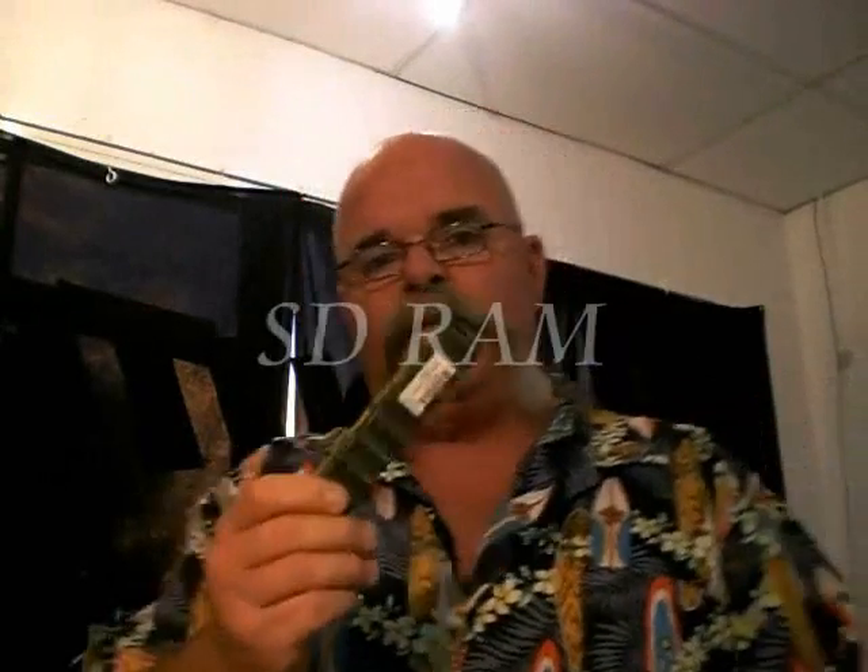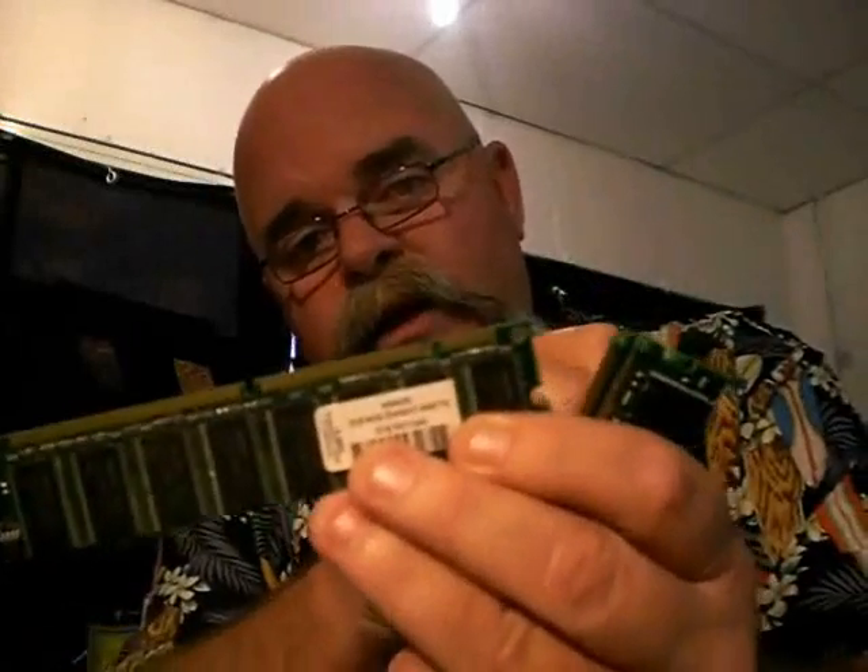Now this is a stick of RAM. This is called SD RAM — this is the very, very early RAM. If your machine is over about 12 years old, there's a good chance it's going to contain SD RAM. How can you tell? Well, firstly, it's got the big chipsets on it, and SD RAM has two little slots right there. If your machine takes SD RAM, no other type of RAM is going to fit it. That's very old stuff and it's pretty hard to get — virtually impossible to buy new anymore, though there's still quite a bit of second-hand stuff on eBay. If you have an old machine that is failing and needs an upgrade and it's running SD RAM, take a tip from me: throw it out and get yourself a new one.